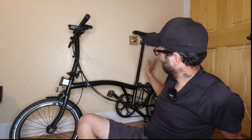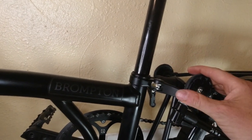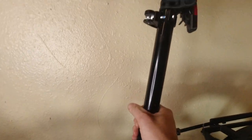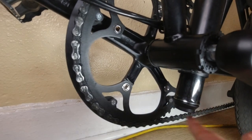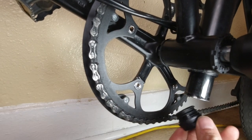There's a place on the bicycle that's actually perfect for it — it's inside the seat post. What we first have to do is unlatch the seat post and lower the seat down enough to where you actually see the bottom of the seat post pull through the frame. When it gets to that point, you need to remove the plastic plug. This plastic plug is a friction fit — you just use your nails, grip inside there, and pull it out. You should pull this plug out from time to time anyway because water can build up in there and start to rust your inner seat post.